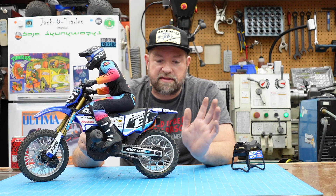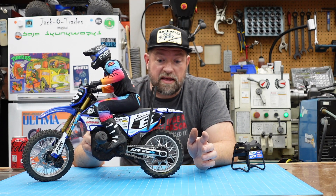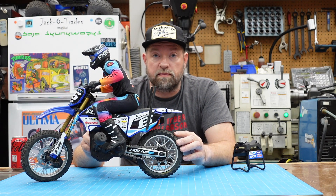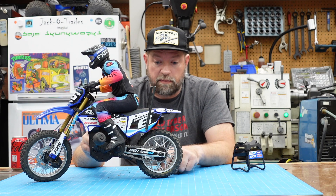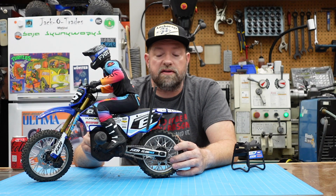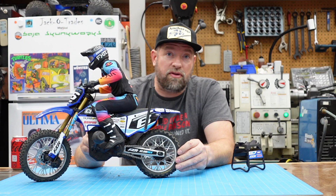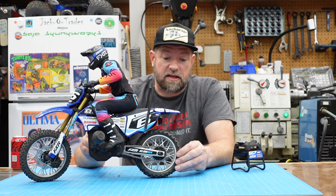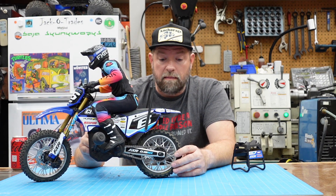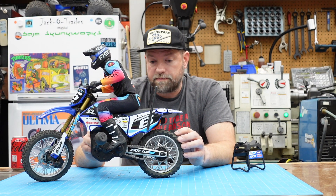I got the setup all put back together and ran it — it was faster. Surprisingly, it was also quieter. The plastic sprocket runs much quieter than the aluminum sprocket, which is a nice bonus. So what did I get? According to my calculator I should have gotten about 58.5 miles an hour. However, I only got 51 miles an hour. But I did go from 39 to 51 miles an hour, which is a huge improvement. I've definitely lost torque — I'm not popping wheelies anymore — but I knew I was going to sacrifice torque for speed.